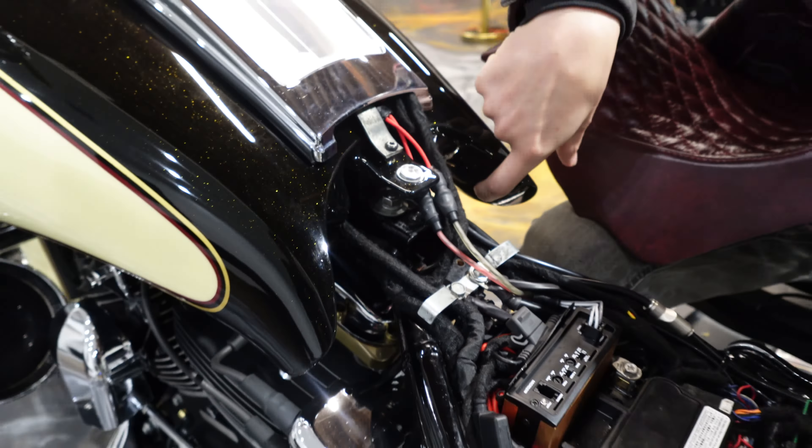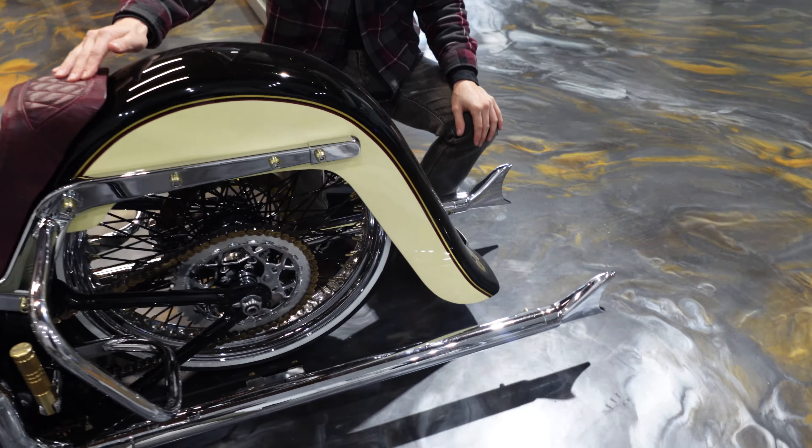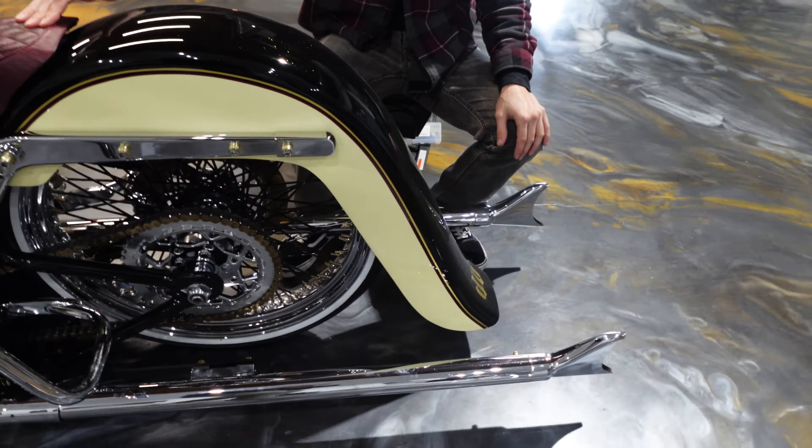We put a brand new fender on it. The last fender felt like it was pushed in a little bit too much, didn't really have that flow of the bike — it ended right here. We had to redo the spacing on the wheel, pull it back a little bit, and fix it. There was an issue with the rotor being too far toward me, and it was causing the pad to create too much heat and discolor the rear rotor. So we fixed all that and got that done.